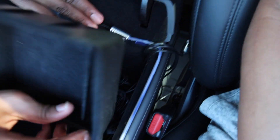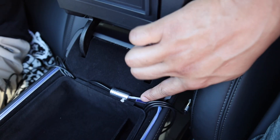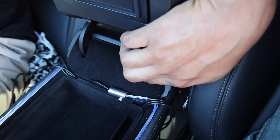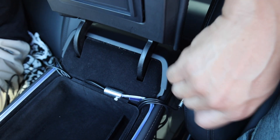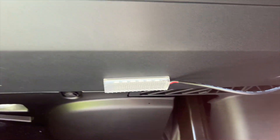We did the seats and aligned everything. We fed it through inside the port where the light comes out — this is wire management, we're gonna clean that up. It came with zip ties so we're gonna get that together. For this one you can let it be a little longer, like another two inches. Now we're just gonna install the underneath lights — it comes with four, two long ones and two shorter ones. The longer ones go underneath the passenger side and driver's side at the front, the shorter ones are for the back.